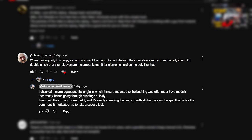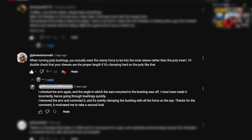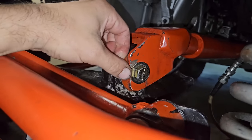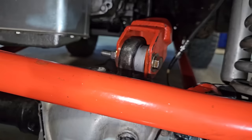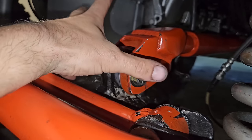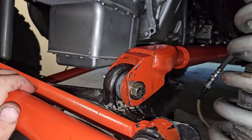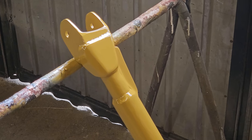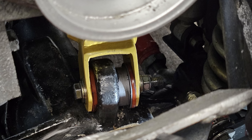I do have a thank you to say, and I think his name is Phoenix2Math — he was a subscriber. He commented on the last video and said the engagement on that bushing looks kind of weird, it's pinching. I had a feeling that was a problem but wanted to ignore it. After his comment I took the arm out, and he was absolutely right — it was at a slightly incorrect angle and pinching down on the polyurethane. So I took the arm off, cut it, re-angled it, and extended the lengths of the ears that go over the bushing. As you can see now, it's looking a lot healthier under there, apart from the colour of course.